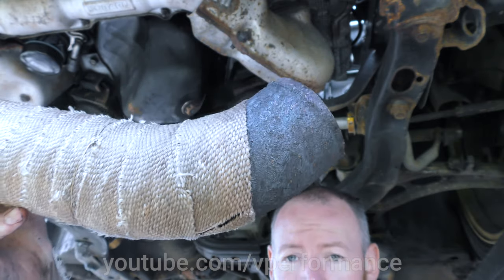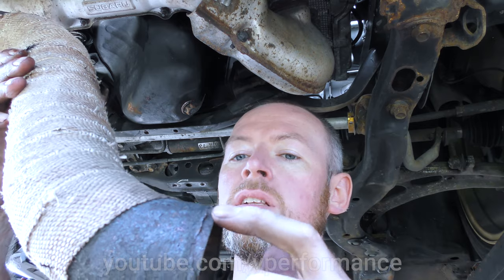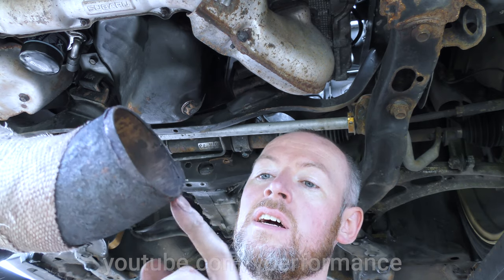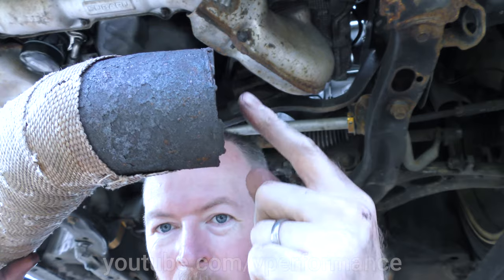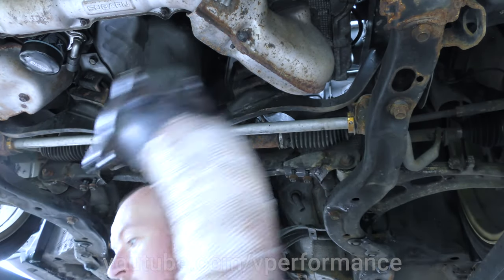What I think has happened here is that this end piece is slightly wider and then they joint it — you can almost see there's a little bit of a joint there — and it slips over the other end. It looks like at that join it has eventually broken off. You can see the last remnants of the weld. So we already had a failure at the top because of the heat wrap, and they made a failure at the bottom for the heat wrap.